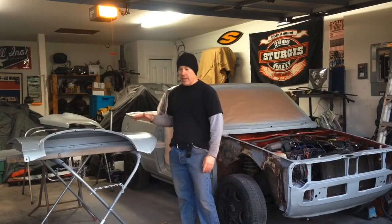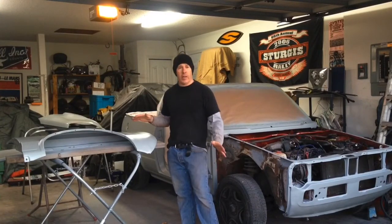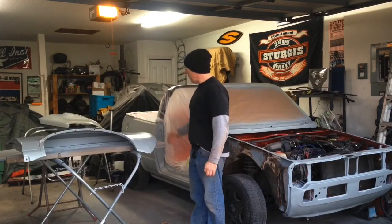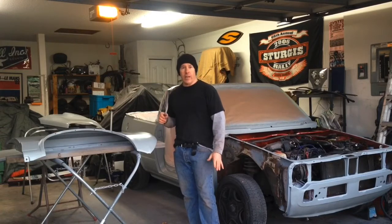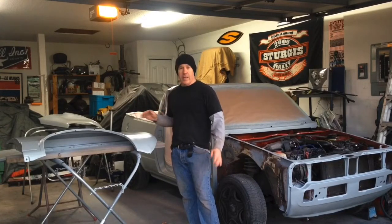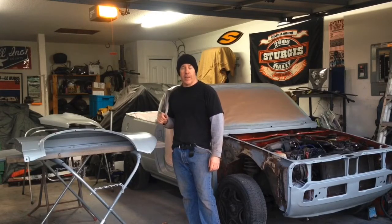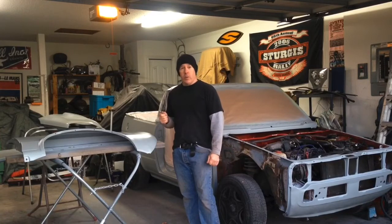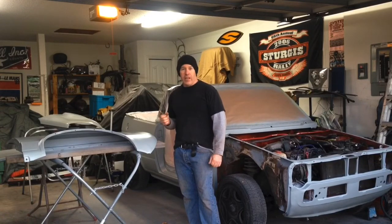Okay, so that's it. I've got epoxy primer and high build primer on all the body panels. I'm going to lay these in here overnight, just let them settle down and set up before I do anything else with them. That will be the end of this episode. I'm really relieved to have this done — it's kind of a major step in the body work. Unfortunately we've still got to do some block sanding to get it nice and smooth before we put the paint down, but I'm really happy with how it's coming along. If you've enjoyed this video, please like and subscribe, and we'll see you next week on Analog Generation.